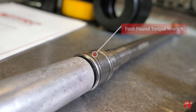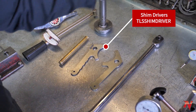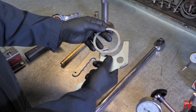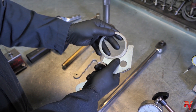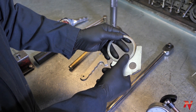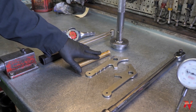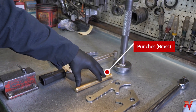Good old foot-pound torque wrench for torquing your ring gear bolts and torquing your cap bolts. Next we have our shim drivers — these are useful for installing outboard shims. Notice they fit real nice together like that. When you have to hammer in the shim, you're not bending it just by hitting it with a hammer.